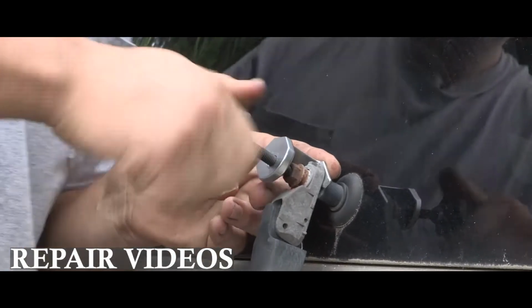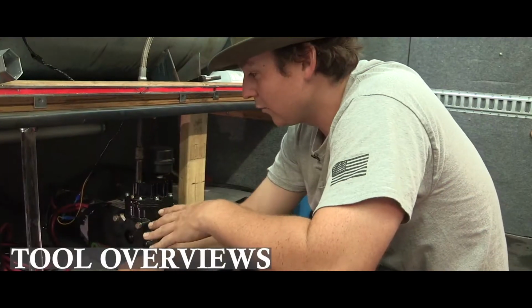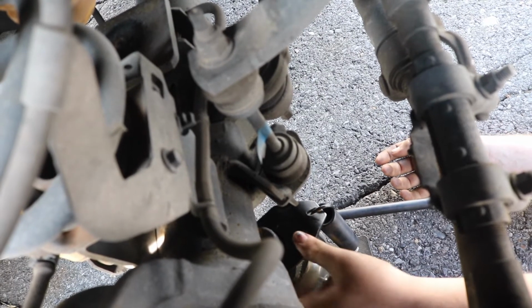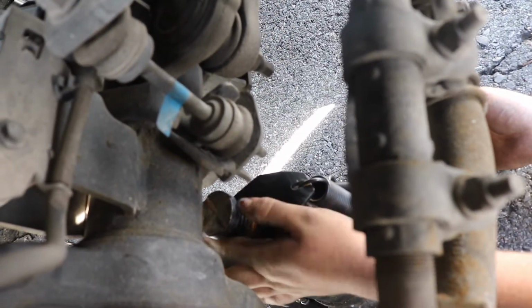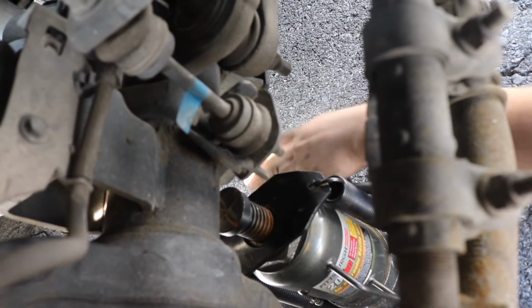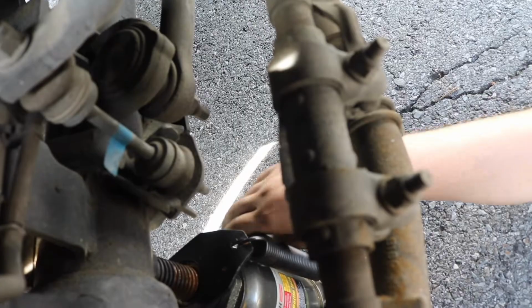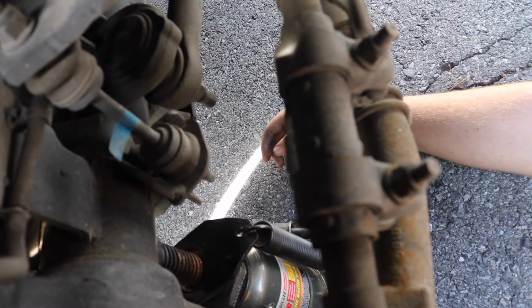In this video, Sammy's going to show you how to replace the front brake pads and rotors on an F450. So, you could probably use a normal jack, but I'm just going to use a bottle jack. And a good place to jack these up by is this bracket here, axle, front diff, lots of different places. So as you can see, the wheel is just barely off the ground now. So you can take it off so you won't have to fight as much putting it back in.